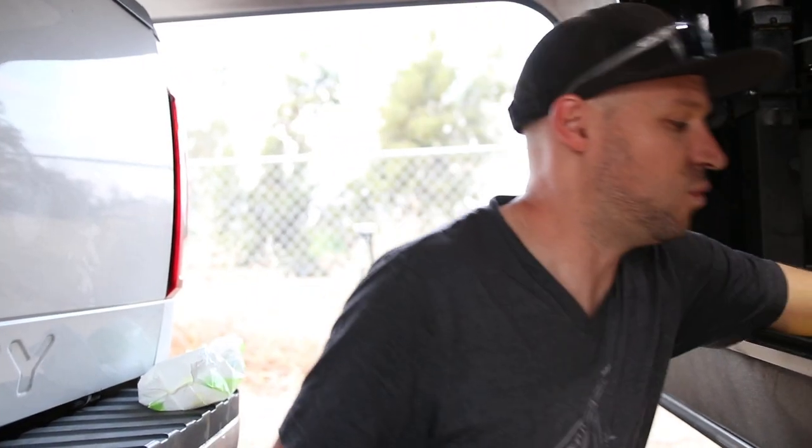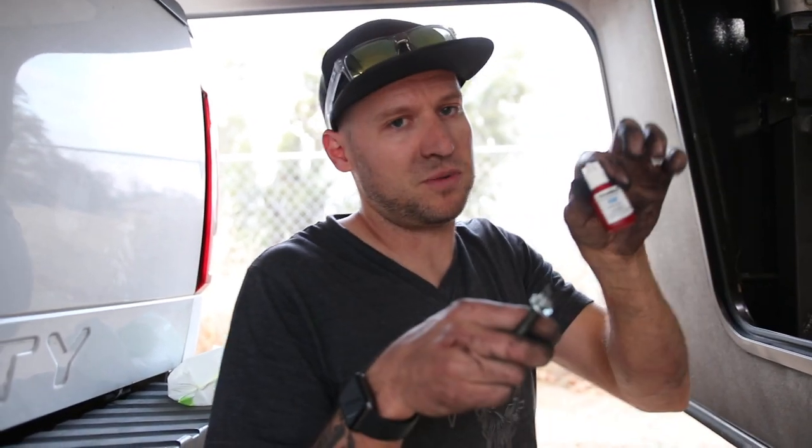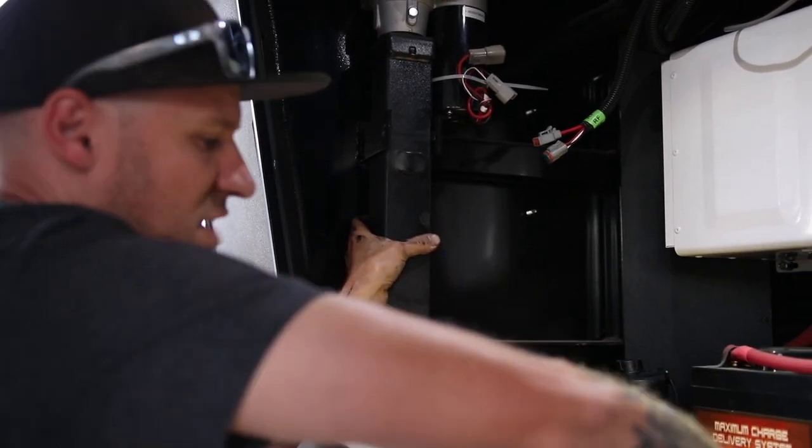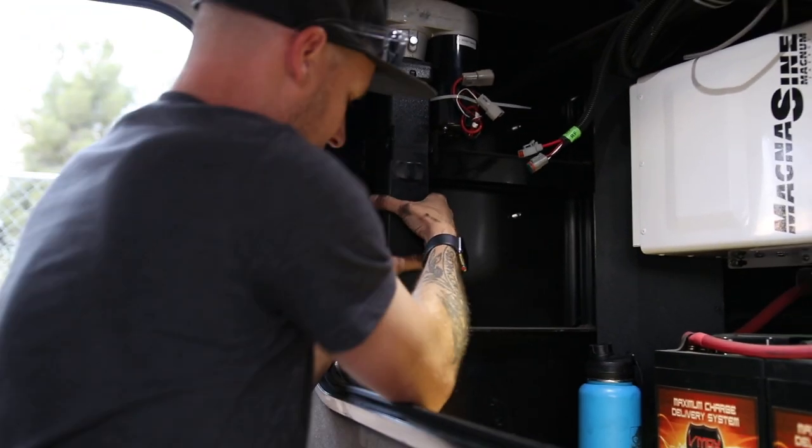Whenever I'm fixing something on my rig, I like to fix it better than it was originally designed. In this instance, a really cheap but effective improvement is to use a split locking washer that fits the carriage bolt, and then put a couple drops of blue Loctite on there when mounting the new jack — just to ensure those bolts will never come loose unless you want them to with a wrench. Now I'll pull out the other carriage bolt; I suspect we actually won't need to remove the motor.